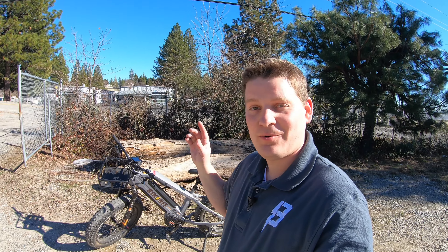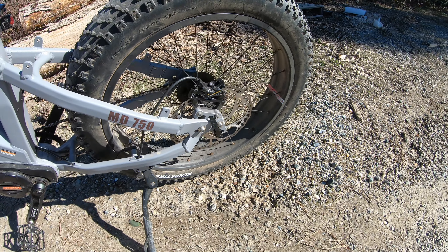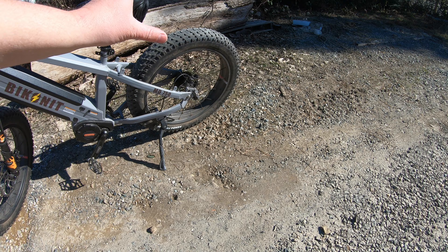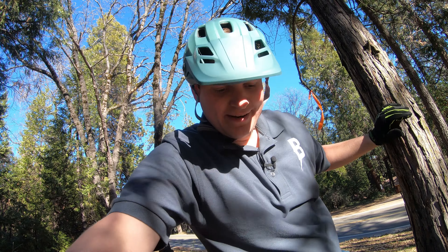This is so big that it probably won't fit on a lot of bikes. So if you have any intention of buying these, make sure you measure your bike first and check any specifications from the fork manufacturer. This thing is just astronomically huge. It may not clear the frame — in some cases it may rub on your fork. However, on the bikes it does work on, I wanted to see: is there anything such as complete overkill? Is there such a thing as too much braking power? Remember how these are 1.8 millimeters — bumping up to two millimeters — these ones measure on my calipers a whopping 2.3 millimeters thick.